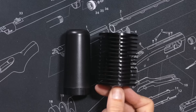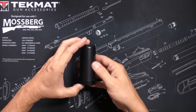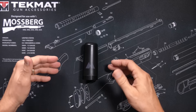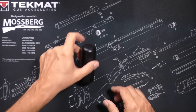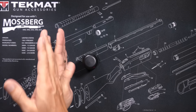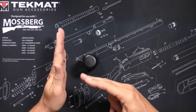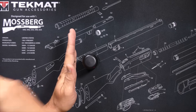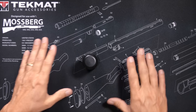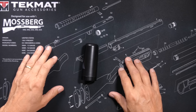No better than a dummy load. Now one very important thing to remember about this antenna, or any ghost antenna, is that because a ghost antenna is so small, if you mount it in a poor location where parts of the vehicle are blocking the RF energy — where a taller antenna might reach above whatever is blocking — it ain't gonna work. Always mount your antennas in a good spot on your vehicle.